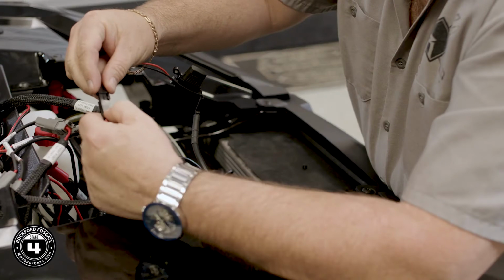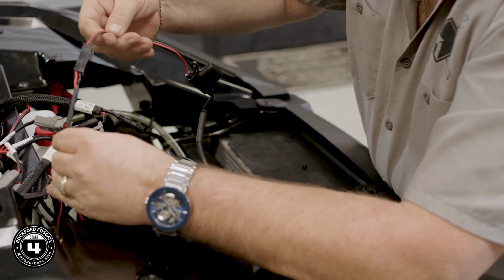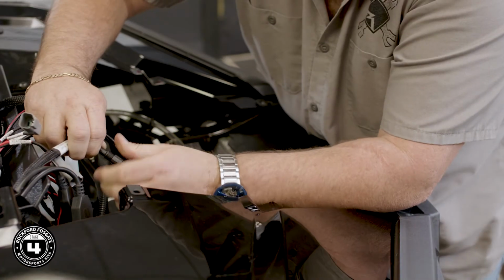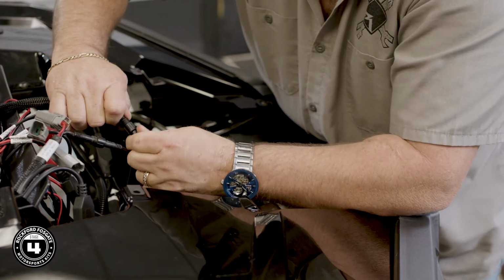All right, you're ready to install your new color Optix controller. This is a Bluetooth device that will allow you to remotely access the lighting features through the RF Connect app. We'll start by connecting the power cable to the PMX harness, and then attach your waterproof connectors to the speaker cables. You can utilize any of the 8 color Optix plugs provided.